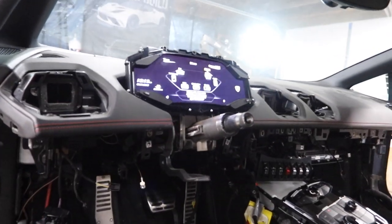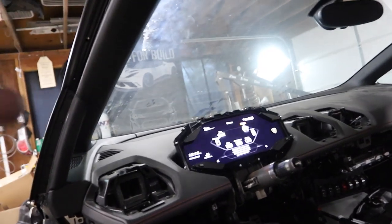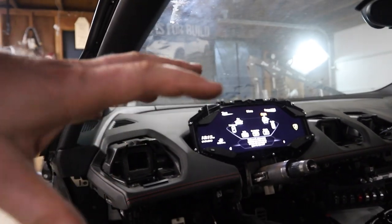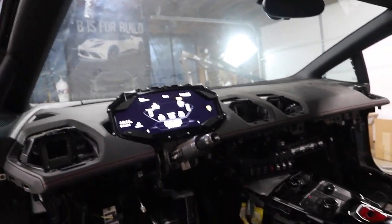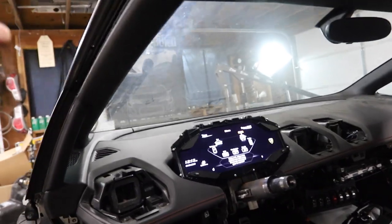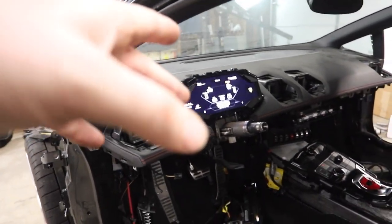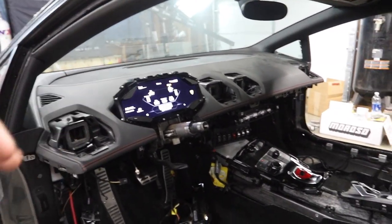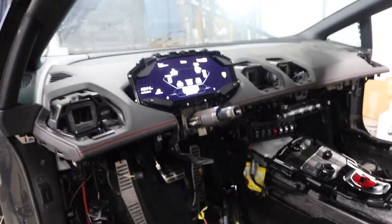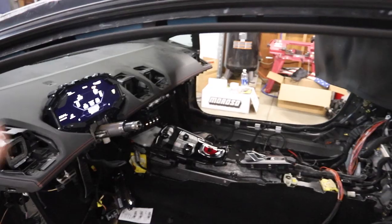This is really great — another step forward. We'd be really close if we could just... well, we're very close. But this is just a menu that's not part of the ignition-on sequence, so we're still not there yet. It's not reading the key and giving us ignition on. One interesting thing is it now thinks the VIN for this vehicle is my green Huracan's VIN. We're still locked out from the whole ignition concept — possibly related to being in neutral without a transmission control module — but we're going to keep working on it.